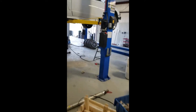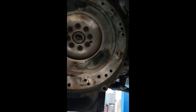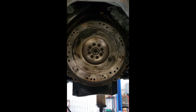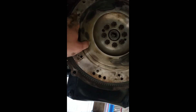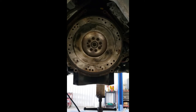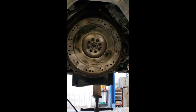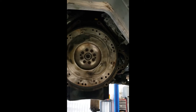That flywheel would have to be resurfaced — it is toast. All because of a clutch cable. That's also a 10 and a half inch disc and we're going to an 11 inch. Luckily you can't do that unless you have an aftermarket flywheel that allows it. You can see there's some holes on the outside and on the inside — this is a Spec lightweight steel flywheel and it allows you to use multiple size clutches. A factory flywheel does not allow you to do that. The RAM clutch I purchased is an 11 inch.